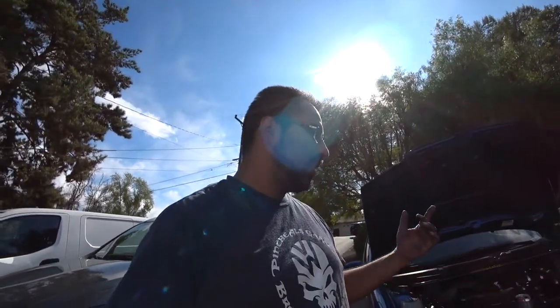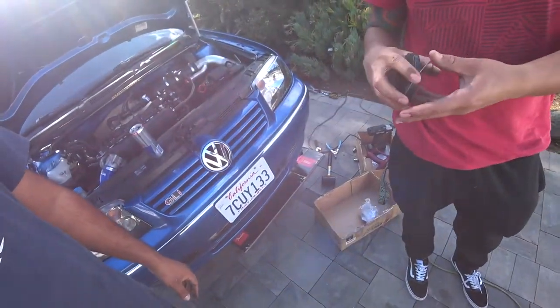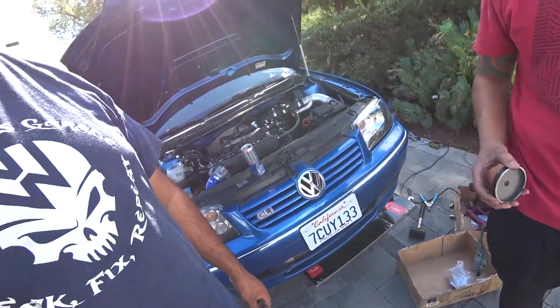This pretty much, if you guys own any 6-speed transmissions, stops the chatter or rattle inside a 6-speed transmission. This is the kit — I got it from the dealership, I'll give you the part number. It's a shim that they actually use on the Mark V 6-speed transmissions, the O2Q. This actually works with the O2H and the O2M, which is the 6-speed transmission.